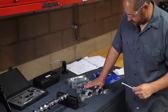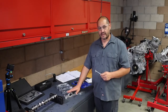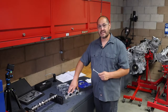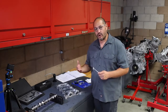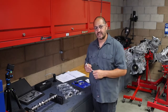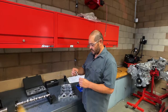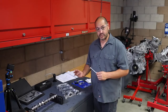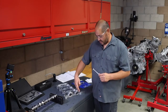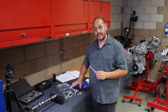Once I have my camshaft journals clean and ready to be inspected — if the camshaft journal has caps, the caps need to be torqued down. If it's just a bore in a block, you need to make sure everything's clean and you have a telescoping gauge that's going to reach the opening. I'm going to measure on two axes, because we want to make sure that hole is actually round and not egg-shaped.